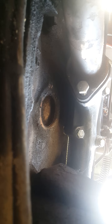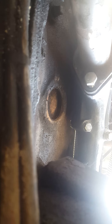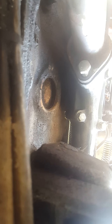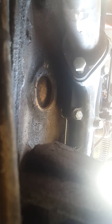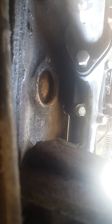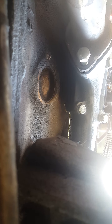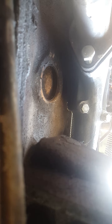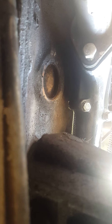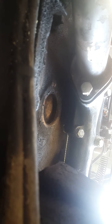The rear bolt under the starter and the front bottom bolt gave me the hardest problem — hard to get a socket on there because it was so close to the manifold itself. I had to adjust everything around, loosen all the bolts, and shift the manifold a little bit. It was on and off all day. This project took me about two weeks when it should have just taken one day, so that gives you an idea of the lack of skill set that I have.